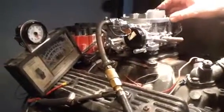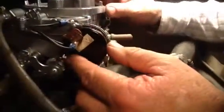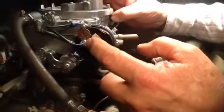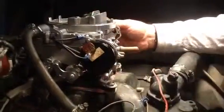Getting into cold weather, I will tell you how to set the choke. When it gets below 45 degrees, you loosen up those three screws and you turn that thing until that blade touches like that — you'll see it turn. Retighten the three screws and the blade will stay right there. Put your hot wire right on here that's hooked to the key. When you turn your key on, as it gets hotter and hotter, it goes up like that. No kicking, no flooring, no pushing, nothing.